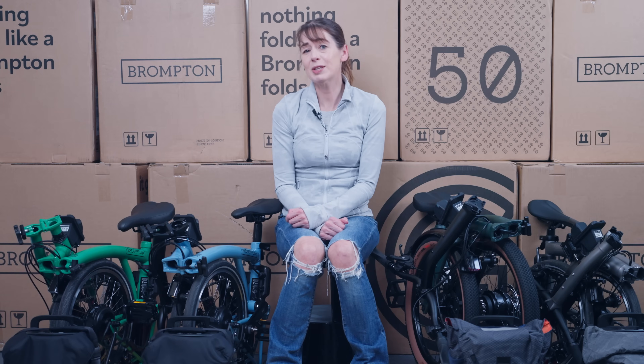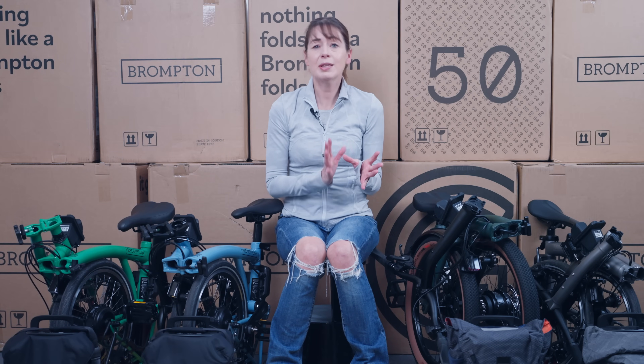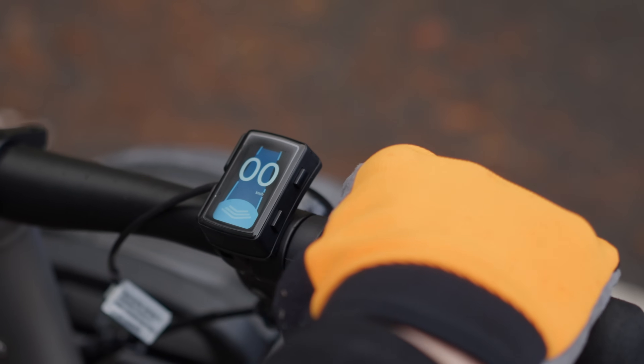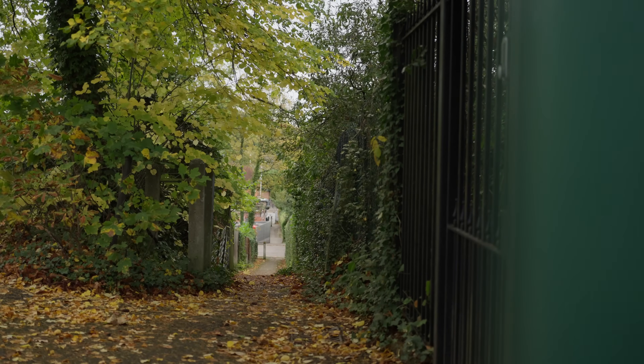There are two side buttons as we mentioned earlier. Let's start with the bottom button as it is actually more interesting than the top. This is used for the walk assist and start assist modes — although the walk assist we actually call jog assist because you have to walk quite promptly. They are two different functions. Pressing the bottom button brings up this screen and you have 20 seconds to decide what to do. If you change your mind, press it again to cancel. Walk assist mode: press the bottom of the screen and the bike will start moving, up to six kilometres an hour. As soon as you start pedalling, the assistance will stop — that is, if you've let go of the screen.